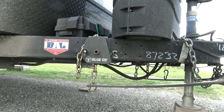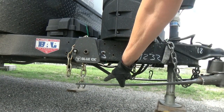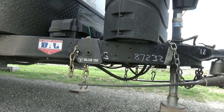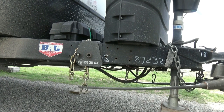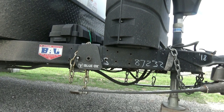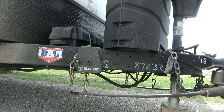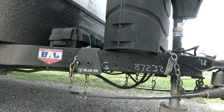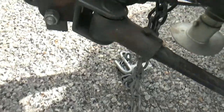As I am lowering the front end of the trailer, you're going to notice that the bar is going to start to bow. The bowing of that bar means that pressure is now being placed equally across — it's distributing the weight, and it's also going to provide anti-sway. What you also want to notice is that ours is adjusted properly so that the back end of the van is not down, the front end of the trailer is not down, and it's not in an apex — it's level. Once I have finished that, we make sure it's locked on there.